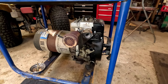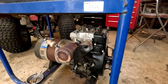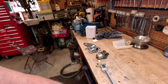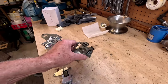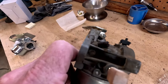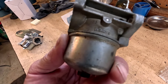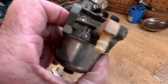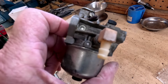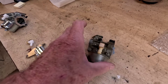I've got the old carburetor removed — it's off of here. It's just a regular Briggs & Stratton engine. Let me show you all the issues I've had with this thing. The old carburetor — I don't know if you can see the number on that — it's a Walbro, number 46-49-83 or 7.